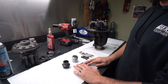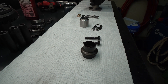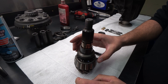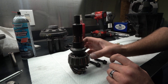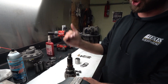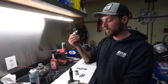The things that come in the diff factory are this crush sleeve and these two bolts. This crush sleeve goes onto the pinion, and this is what sets the preload on your two pinion bearings. When you tighten down the nut, it squeezes this crush sleeve and that sets your preload. That's all fine and dandy until you go to the track, start jumping over rumble strips, and put a hard load on the differential. It puts a bunch of shock load into the pinion, it actually crushes this farther, you get slop in the bearings, backlash in the gear, then it blows up. This is a notorious problem.